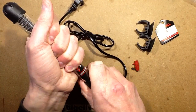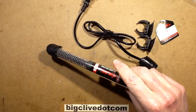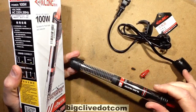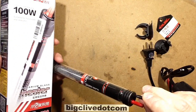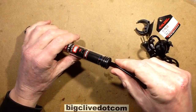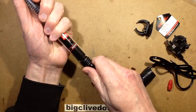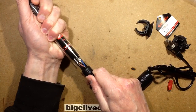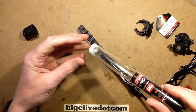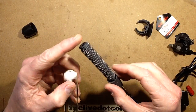When you pull this end cover off, it reveals a rubber seal. On the box it kind of shows this being fully submerged under the water — I'm guessing that's just so the thermostat gets a good indication. It just makes me wonder how watertight it will be up here, but I suppose ultimately the fact it's jamming into the glass tube will make it fairly water resilient. If you carefully ease around this it takes a bit at first, but you can pop it out, and it reveals at the bottom a little wad of what I guess is rock wool type stuff — sort of fiberglass — just to keep it from getting too close to the end.